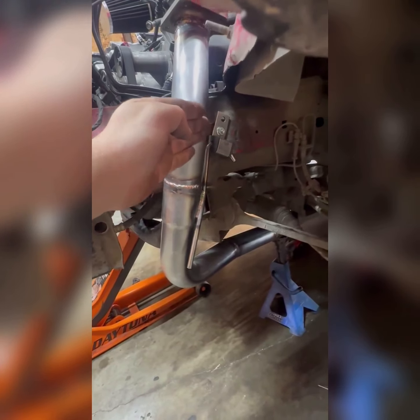After your mount is in place and secured, life starts to get a little bit easier. You now want to get underneath the vehicle and put in the alignment bolt, which goes in the existing clasp thread, I think is what these are called. Anyways, you mount that there. It will be a 10 millimeter bolt, provided. Boom.